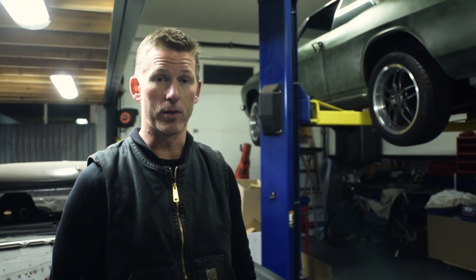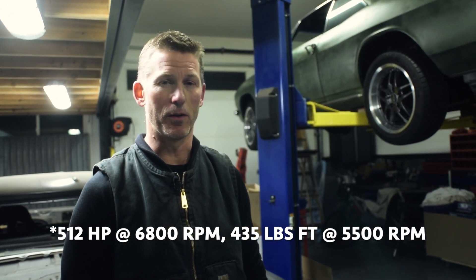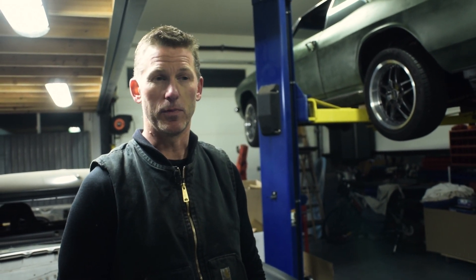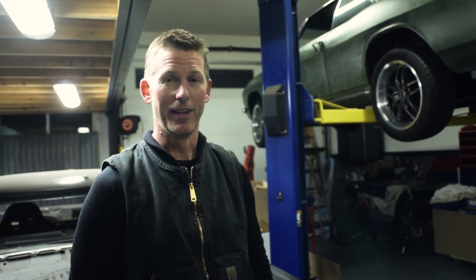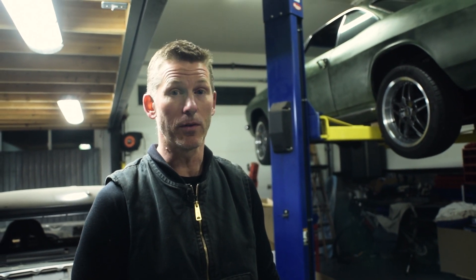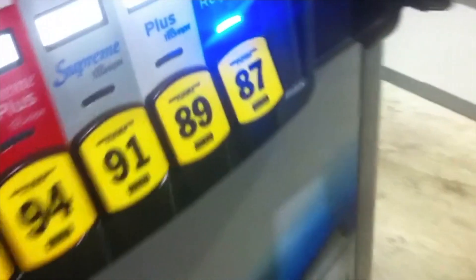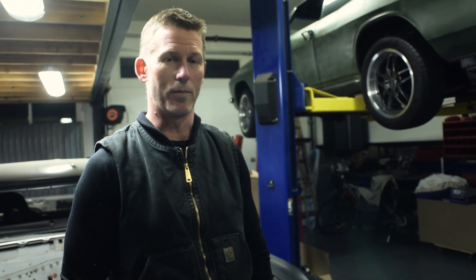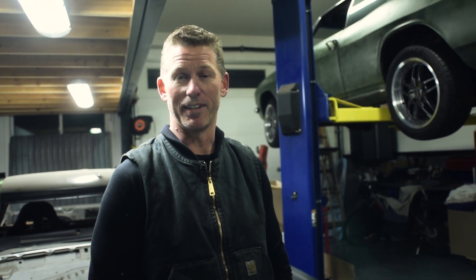It also made a little bit more horsepower — 512 horsepower somewhere around 7,000 RPM. The torque was about 435 lb-ft. We thought that was pretty impressive with a three-inch stroke crankshaft making 435 pounds of torque. Does it have to do with the 2-to-1 or 2.1-to-1 rod ratio? It's high compression, but it ran on 87 octane — so there's something there. We've done other engines with 327 cranks in a 400 block, and now we've done this 283 crank thing. It was an interesting project and it's worked out really well.